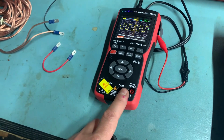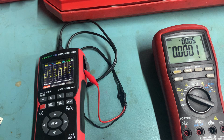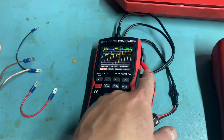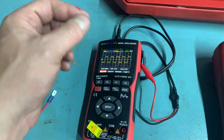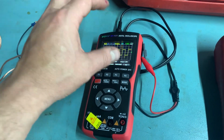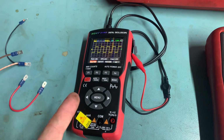Also, I had a problem with the indicators on the Delorean, and if you just put a voltmeter onto the output, because it's switching on and off, you can't really see what's going on. Whereas with an oscilloscope, if you have it on a slow sweep, you can see it. It would actually look very much like that. I was just on the test port at the moment, but you can see the indicator coming on and off. And on the Delorean we actually had a loose connection, so when you were wobbling the wires around you could actually see the signal breaking down and disappearing, which with an ordinary voltmeter you just can't see. You can't see the electricity in 2 dimensions, which is really all an oscilloscope does.